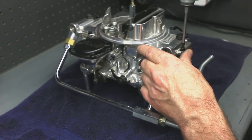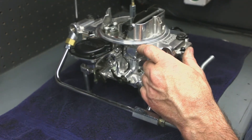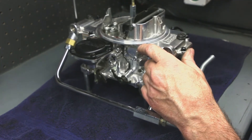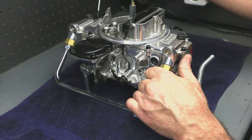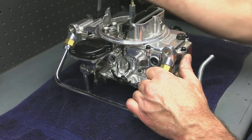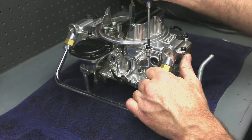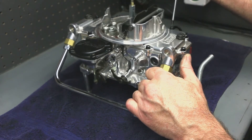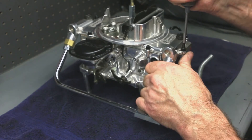So far this has been a pretty good 4x4 carburetor. I'm running the float levels a little lower than you would normally run them, so it's right at the bottom of the sight glass. It seems to run fine there — up and down hills and off-camber it doesn't want to flood out or stall. Stalling when you're trying to climb or go down a steep hill is never a fun thing.